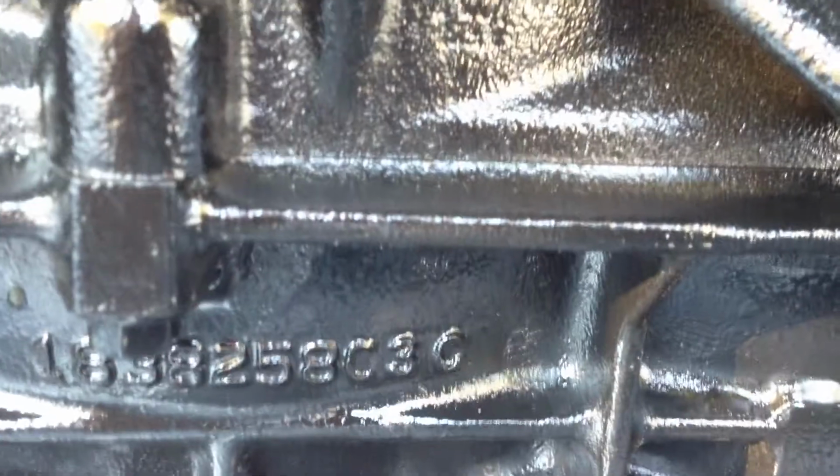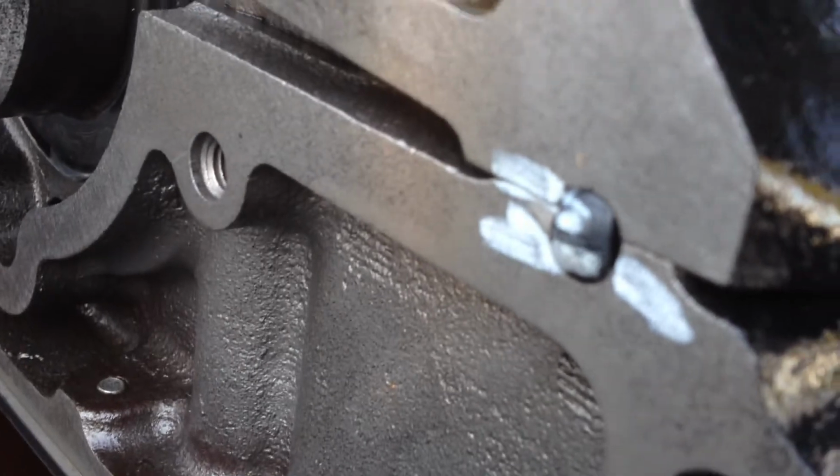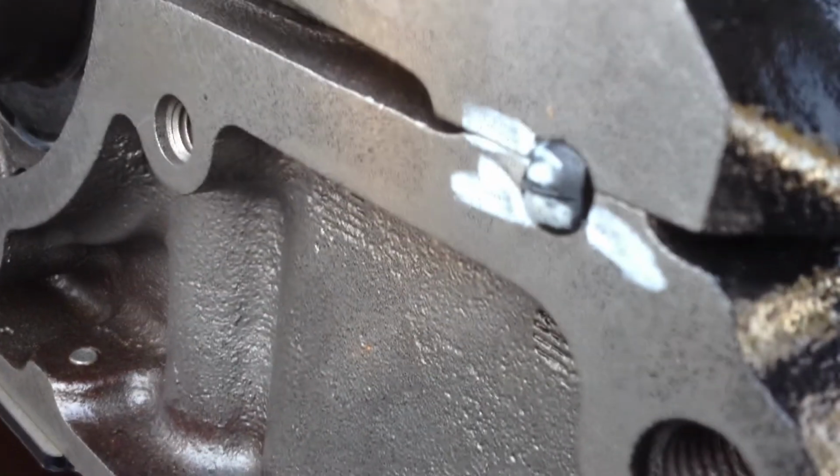We're nitpicky. We don't have any sealant coming out of the bed plate, so my assumption is they did not put any sealant along the length of the bed plate. They put a hair here. Looks like they haven't changed anything. If this was my engine going in my truck, I'd be yanking the bed plate and resealing it. That's what I'd be doing.